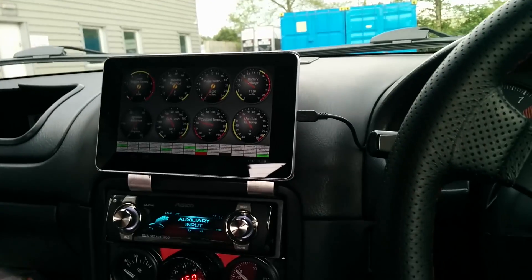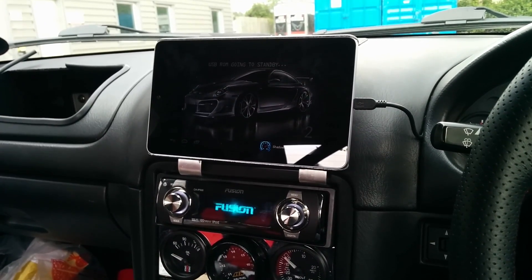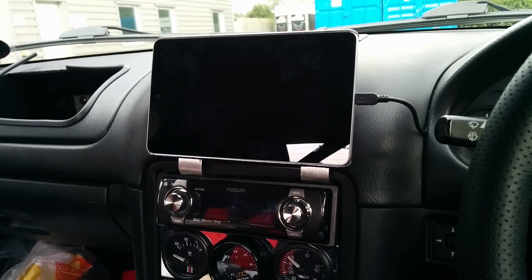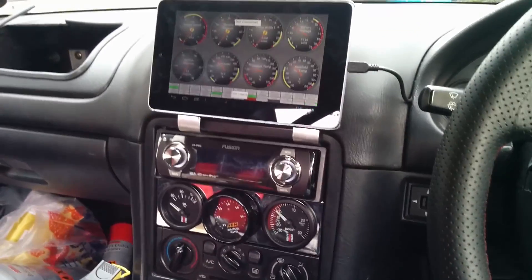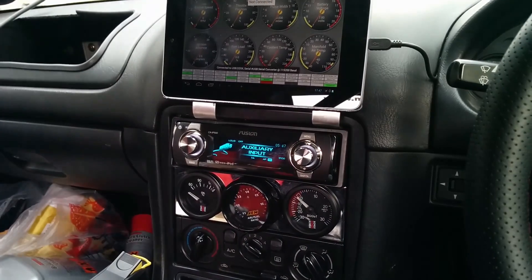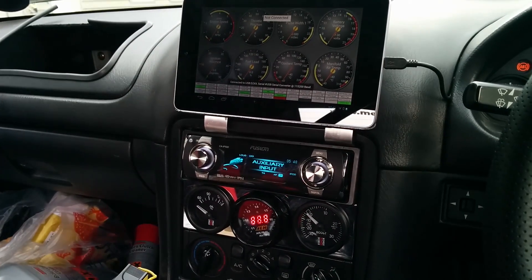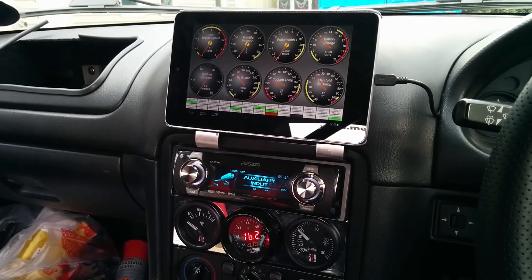Before I start — it's a cold start anyway — if I try to turn it off, it turns off and goes into standby. The way I've got it wired up, the step-down comes on at the first click. It'll wake up, but it won't connect to the ECU because the ECU needs its power from the ignition. So if you're just listening to music or something, that's absolutely fine. On ignition, the ECU connects.